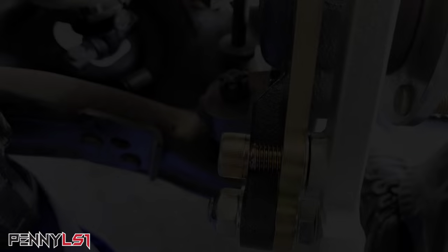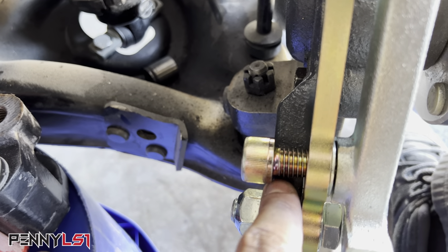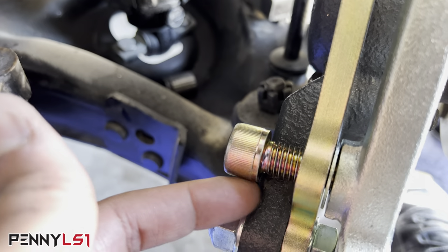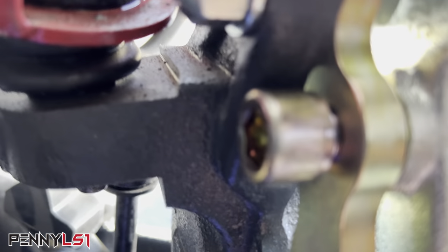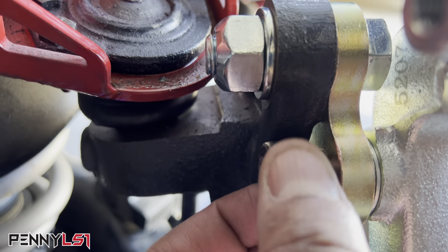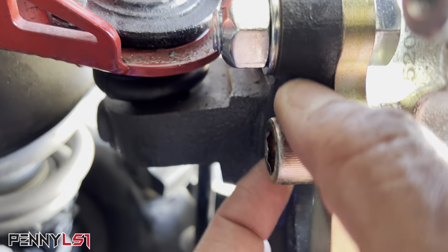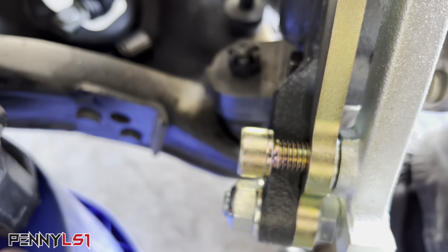Let me show you the clearance issue. See that bottom bolt right here? Two things: I can't turn it anymore because the threads are actually rubbing up against the spindle. And also, once it gets far in enough, the actual head of the bolt — the shoulder — is resting up against this. So we're going to have to grind it down enough for the bolt to go in and for the head to clear. Up here it's the same — it's rubbing at the top right there. So I'm going to mark a line right here and grind in between the two lines. Same thing down here.